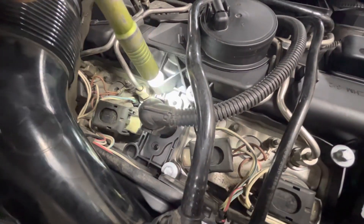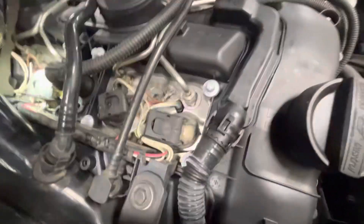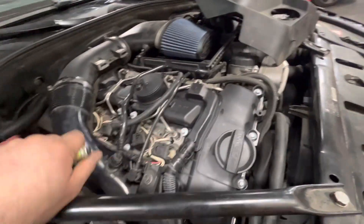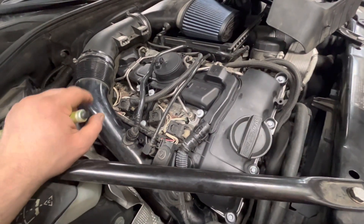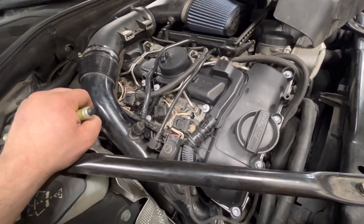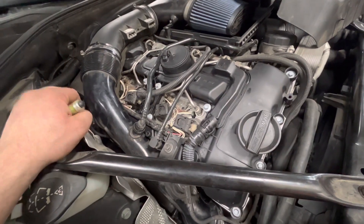This actually causes a leak. If you have a leak on the valve cover into the crankcase on an engine like this, it actually messes with the fuel mixture, because intake vacuum is applied to the crankcase — so it actually is a vacuum leak.